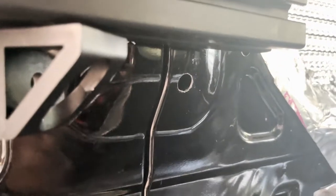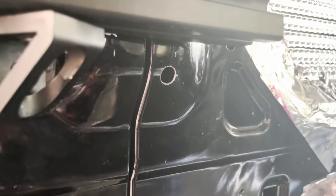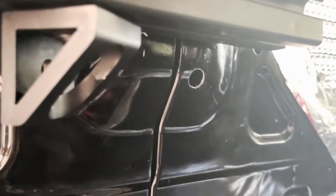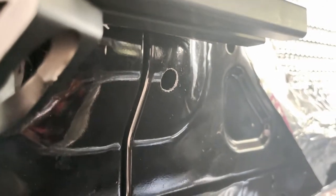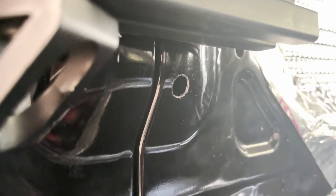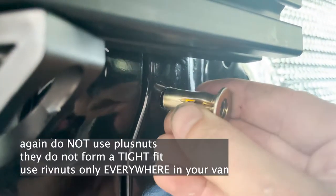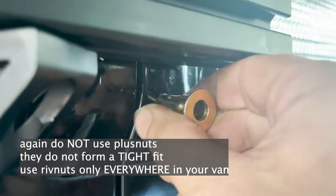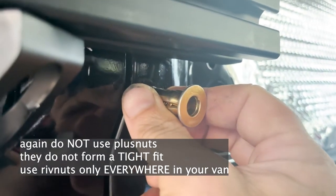This was a scary thing to do. I didn't go with the aluminum idea — I'm just going to try to install a plus nut into that weird curved shape and hope it works. On the other one I used a rivnut and an 80-20 bolt, but on this one I'm experimenting with a big heavy-duty brass plus nut and a carriage bolt from Home Depot.